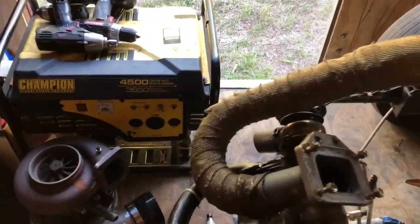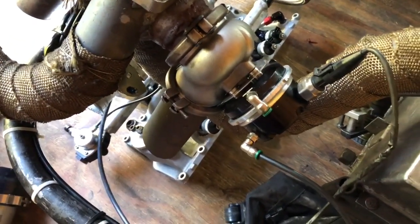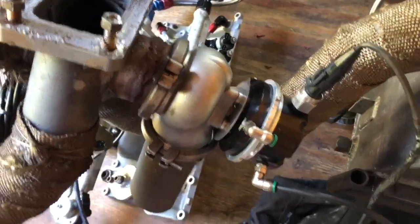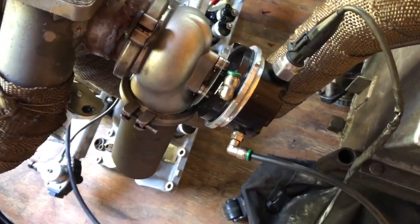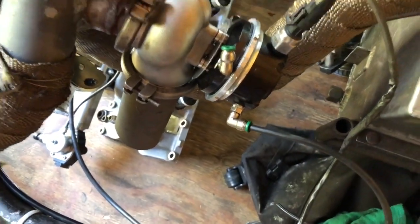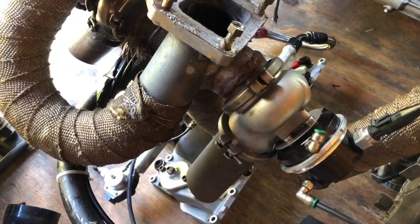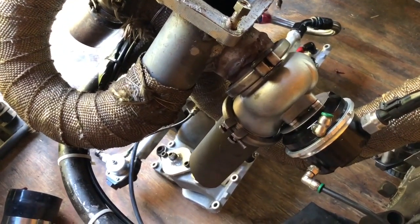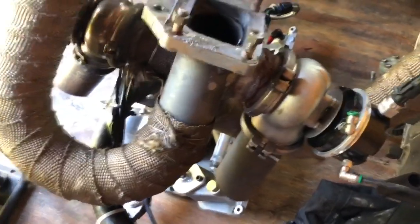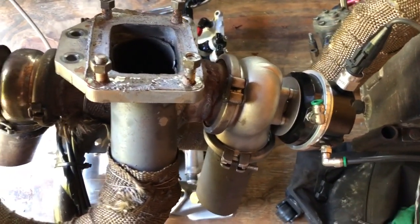The CO2 pressure comes down — I've got two waste gates. On mine it goes to the top of this waste gate and then to the top of this waste gate. This is the transducer that tells the Holley how much pressure is actually on top of the waste gate. The bottom port on the waste gate goes to the compressor housing like normal, so it's able to read boost acting on the lower side, and you get CO2 pressure acting on the upper side. You build a ramp — you want to start off with 10 or 14 pounds of dome pressure, and then when you let go of the trans brake it ramps up to 30, 40, or 50 pounds, whatever boost level you're trying to make. It follows that ramp and starts applying CO2 pressure to the top of the waste gate — that's how you increase boost.